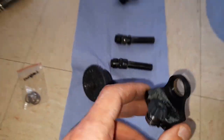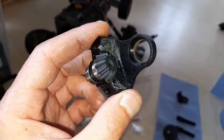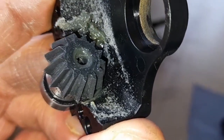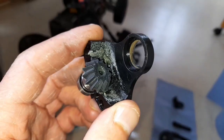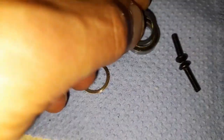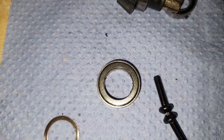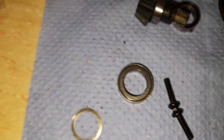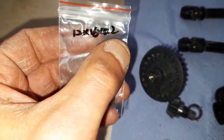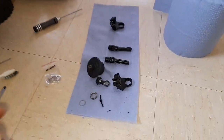So anyways, if any of you guys have got a Typhon or anything like that and you've been running it, after a while your diffs are going to look a little bit like this. So therefore you need to clean that gunk out and get them re-shimmed. So I bought my own shims and I made them slightly larger, just so the bearings actually got more to sit on there. So those shims there are 12 by 16 by 0.2. You can't actually get them in 0.1. I'll put a link in the description box down below.